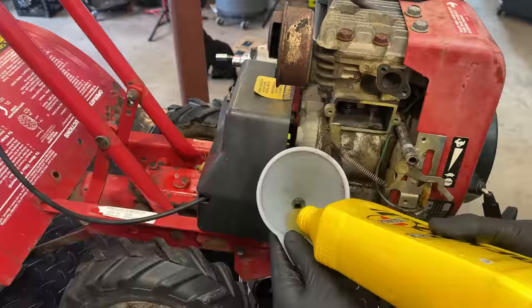So change of plan. Instead of using RTV, I think I'm going to try to make a gasket to seal this up. This plate, I think it's a good way to drain the gear oil in the future because gaskets can usually be reused. And instead of changing the gear oil again, I think I'm going to leave it in there because I do think I got all the water out. But with a gasket, it'll be easy to pull this off and drain it out